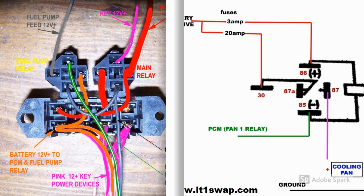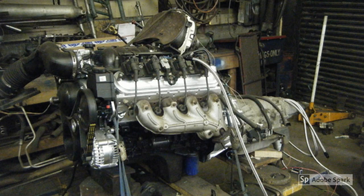I ran an automatic, and Brendan was very descriptive in how to wire up the torque converter clutch, the fuel pump relays, the cooling fans — it was just a really simple diagram to follow. One of the services Brendan at lt1swap.com provides is actually flashing the computer to eliminate the vehicle anti-theft program and other parameters so your engine will run on a stand-alone harness. It came back, worked perfectly, and fired up on the very first time. He's the most reasonable person I've found. You send him all the parameters — from fuel injector size to the type of transmission you're running — and in a couple of days you get it back. I'll put the link in the description below.